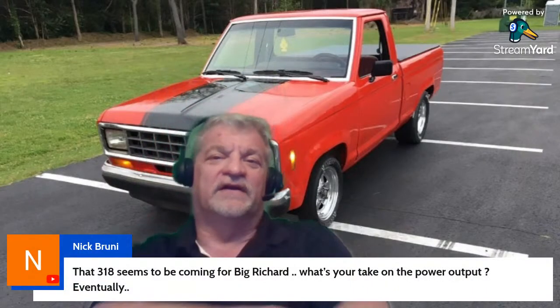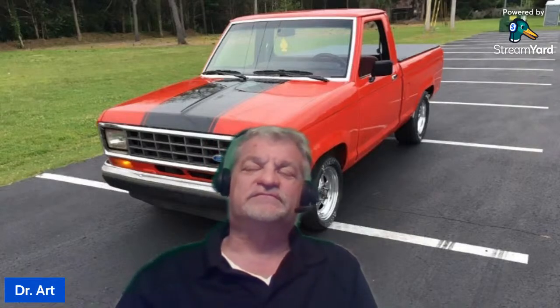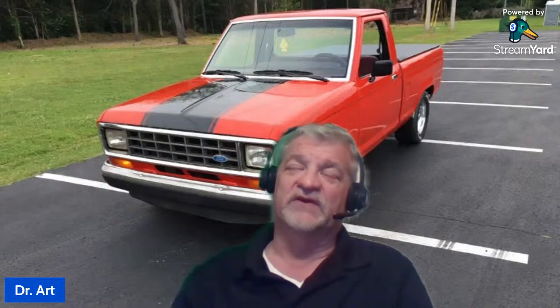Nick, what's Nick's question here? The 318 seems to be going good for Big Richard. What's your take on the power output eventually? I'm going to say 265 to 270 horsepower. That's just because it's a 318 with a little bit of a cam, a 4-barrel, and a decent intake. It's got the better Magnum exhaust manifolds, a little bit of cam and a nice 4-barrel. So it should pick it up a little bit.